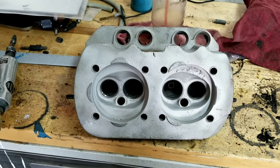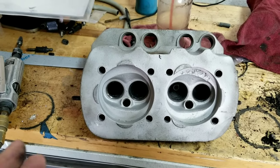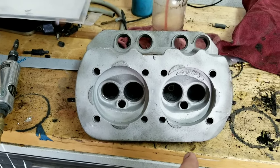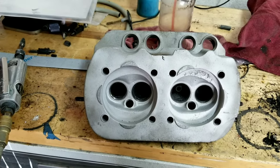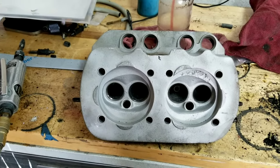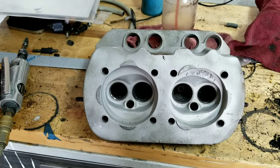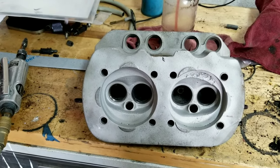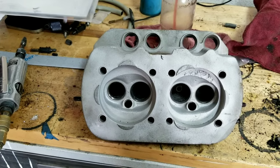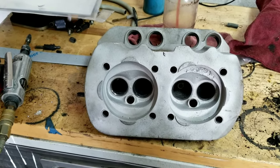If you look that up, you'll find out what I'm talking about. They are slip-in for the 1600 block, and then you can put the 90 and a half heads, and later on, let's say you decided to do your bottom end. So you started out with an engine like this, you could stair-step your way up into the engine you want, as long as you don't blow it up. If it gets to the point where the rods rattle or something like that, shut it down. That's the main thing.